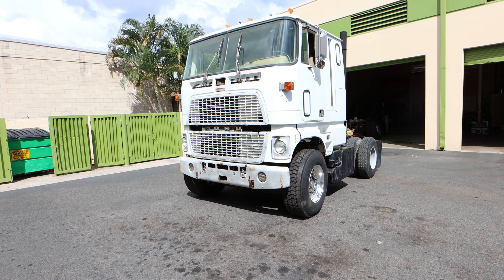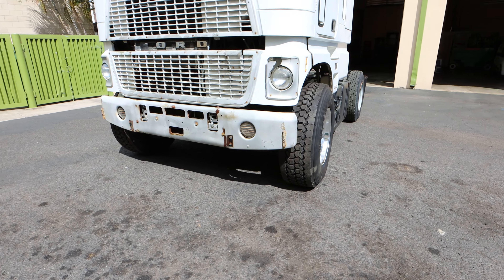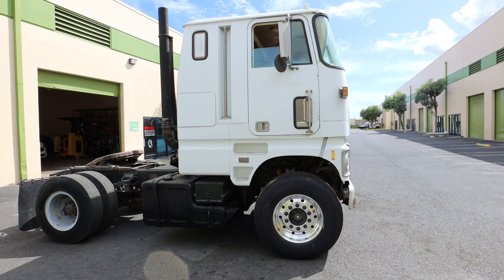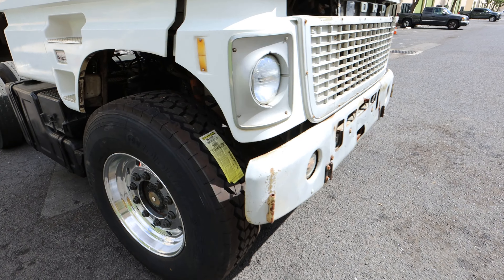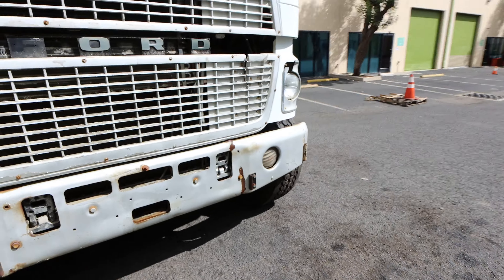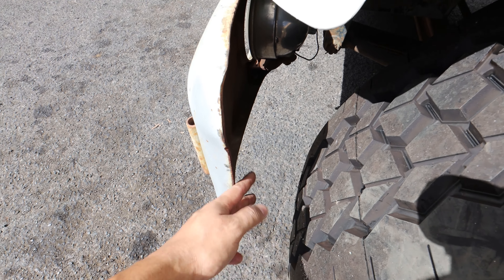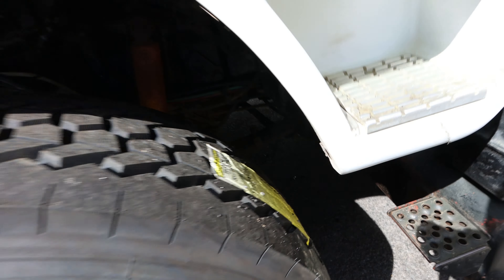The front 385s are mounted and it looks amazing — it's beefy, exactly what I was looking for. These are 385/65R22.5. Now we're going to do the back. Getting the front done first was the priority. We found out one side was fine on clearance, but the other side had been bent at some point — it was almost touching the tire. We grabbed a fork and bent it back to factory position. I made full lock-to-lock and nothing touches; I checked everything inside.